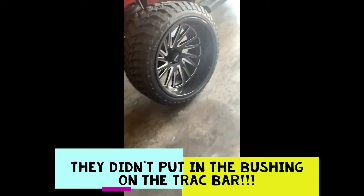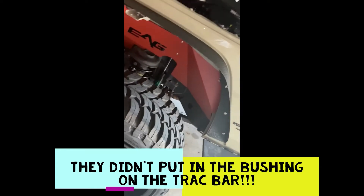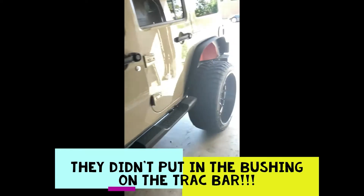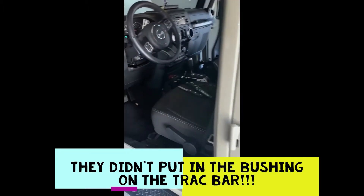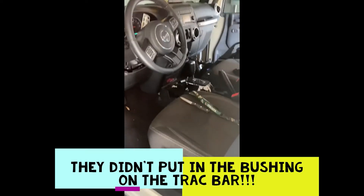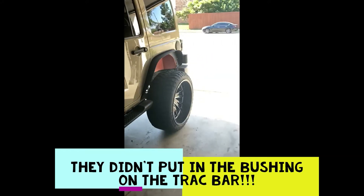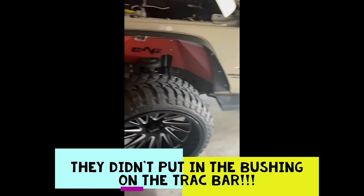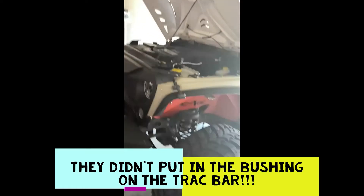I've been having a problem with my traction control engaging after I got new wheels — 26/14 rims with 37s, a lift. They did my lift but I noticed they did not have my steering wheel corrected. My wheel is straight but my steering wheel is crooked. So what's been happening is if I get over about 35 miles an hour, the traction control will automatically engage. It causes the brakes to apply and the wheels to jerk, kind of lurching the wheel.